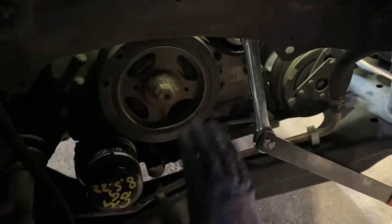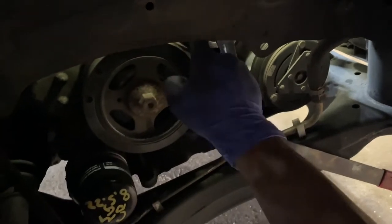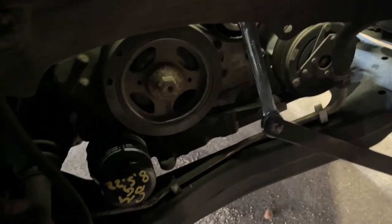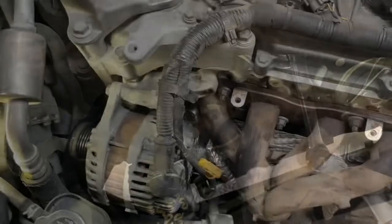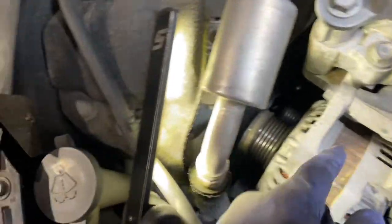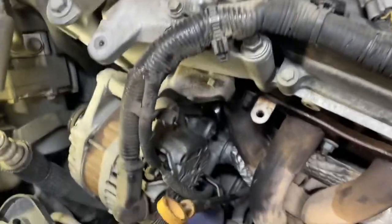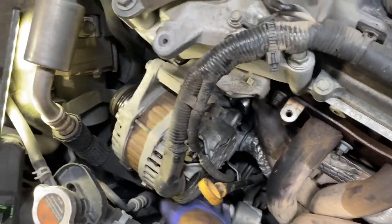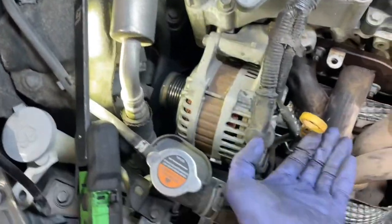You can go from the bottom in the wheel well - there should be a cover right here where you can access the tensioner. Using my drive belt tool with a 17mm on the end, going in and releasing the tension, then just getting the belt out of the way. Once we do that we can start messing with the alternator. Now with the belt removed, I'm going to remove the bolt on the bottom - number 13 - and also loosen the bolt on top, also number 13.